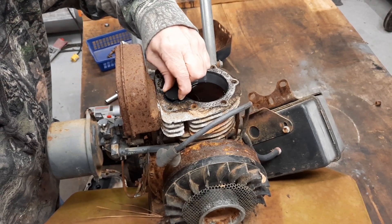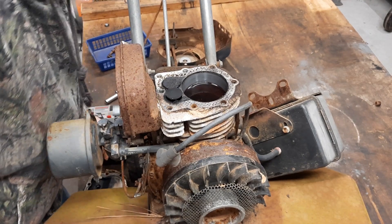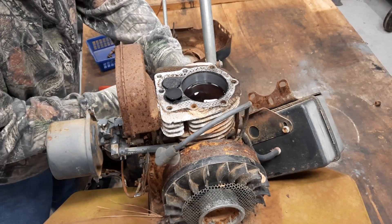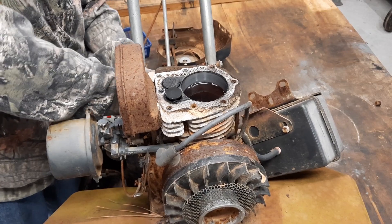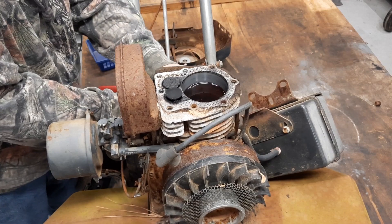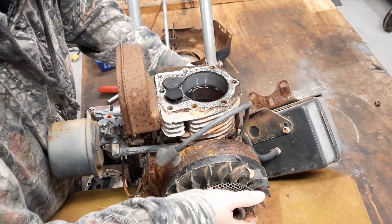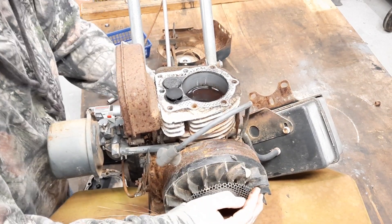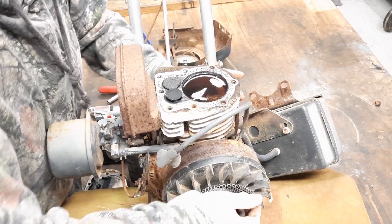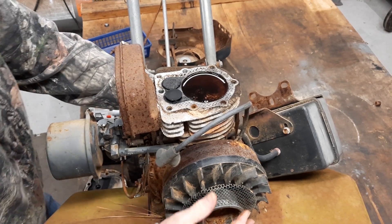Let's see how ugly it looks down there. Good quality pry stick here. Doggone head gasket don't look bad. Still got that fluid sitting on top of that cylinder right there. Doggone, that cylinder don't look like it's got a mark on it. What's going on here? Get this belt popped off on the back side, I'm going to show y'all that — it's a belt. Can't turn the doggone motor.